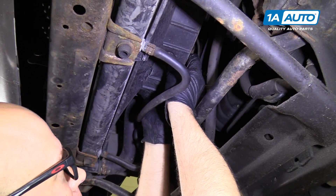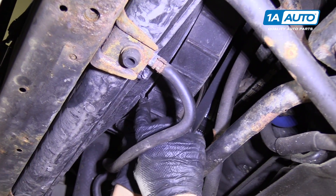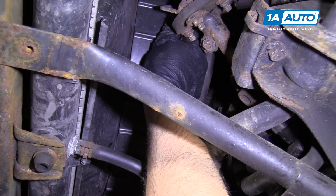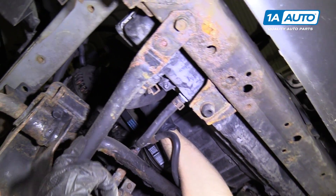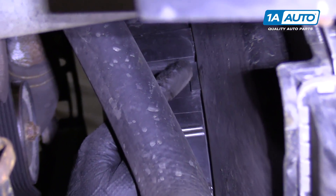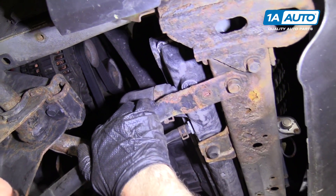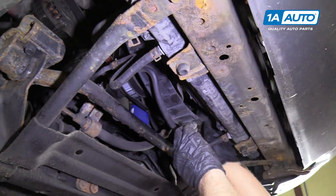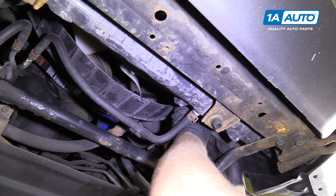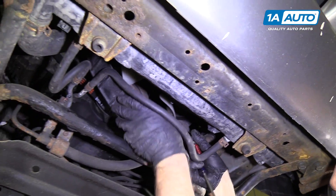Pull it down. So this lower part of the fan shroud has to come off. I'm going to grab the center right here, pull it past that little nub right there. You should be able to slide this out. Up here on the fan shroud, there's a little tab right here. You're going to push down on that tab and pull out — it's going to release the lower part of the fan shroud — and we'll do the same for the other side. It's a little tricky to get your hands up in here. I'll take that piece off.